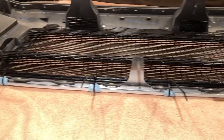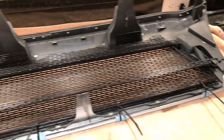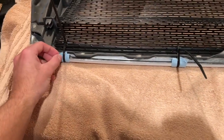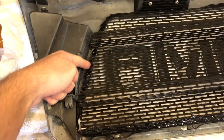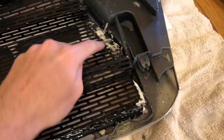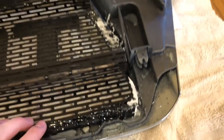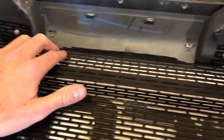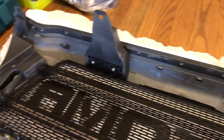To get the mesh onto the back, I'm going to use an epoxy. I'm going to do this in a couple of different pieces — starting along the bottom edge first and then working my way around, so each piece is solid as I go. I'm using zip ties with a little bit of paper towel underneath so it doesn't scratch up the painted surface and keeps it in place. Everything is pretty much glued in — the sides, all along the bottom edge, and the side here as well. Any of the white-looking epoxy, I mixed in some baking soda, which helped it set up but made it more brittle, so I stopped using it. Up at the top there are tabs that screw into the back plastic piece, and I'm running another line of epoxy across the top and down the corner pieces since there'll be a lot of wind pushing against this grille.